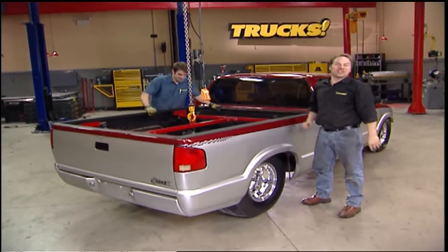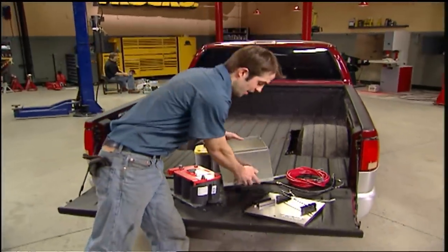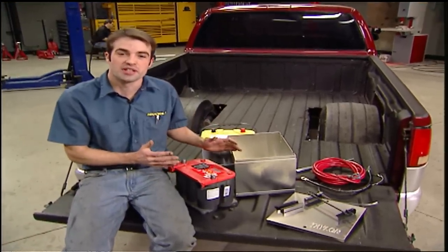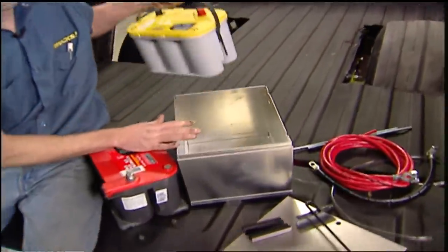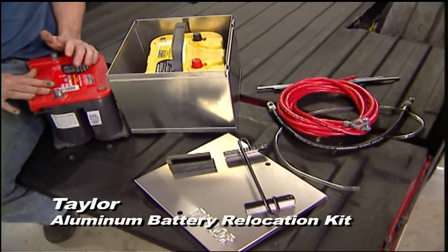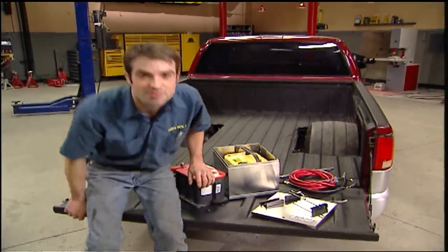The next time you see Haul & S10, we'll take care of the motivation on the front end of this rig. One of the future modifications we're going to make is to relocate the battery to the bed of the truck for better weight distribution. Taylor makes an aluminum battery relocation kit that fits our needs perfectly. This box protects the battery, gives it a nice professional appearance, and is NHRA approved for sanctioned tracks. Taylor now makes boxes for yellow and red top batteries. One of these kits sets you back about $160.